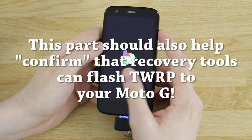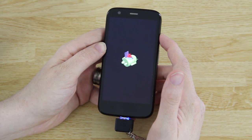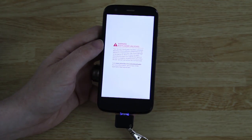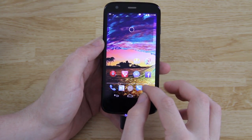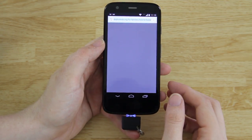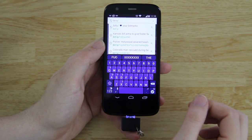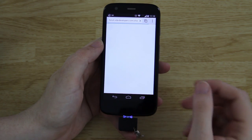It's not wanting to get me into recovery, but I was on version 2.6.3.1 and as of a couple of days ago it updated to 2.6.3.3. Obviously if you're watching this later it could be on 2.7.0 or higher. To update custom recovery, open any browser you want — Chrome, Dolphin, whatever — and go to bit.ly/MotoGTWRP (all caps). Press Enter and it'll take you to the XDA thread. Go down and click Download. When you press on it, it says starting download and then it's done.